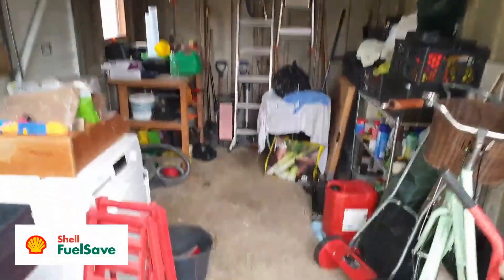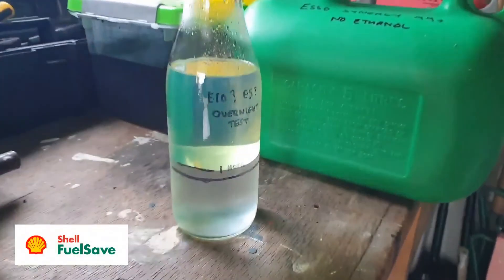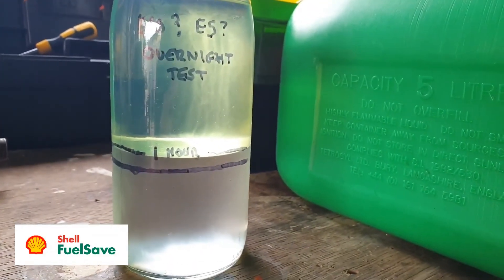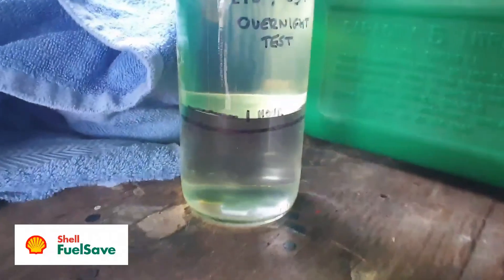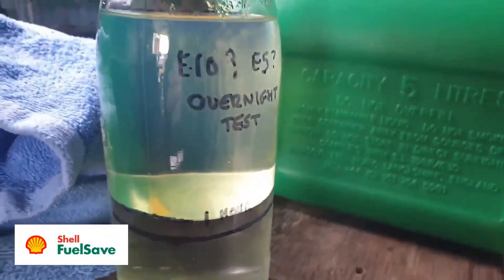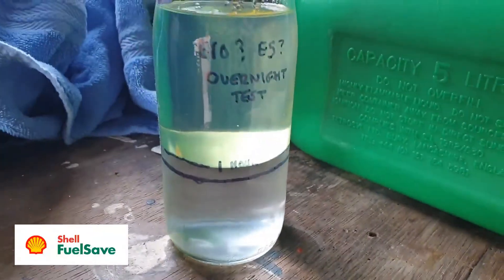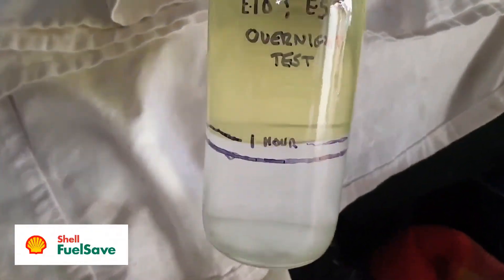Now it's the next day — let's see how our overnight glass bottle test has done. The separation line appears no higher than it was after one hour; in fact it looks lower, but this is likely down to it stabilizing and leaving a thinner, more definitive line than the foggy one traced with the sharpie while settling was still ongoing. This concludes that results after an hour are more than sufficient for our purposes — simply to see that a petrol is either ethanol free or contains a particular amount we can judge as E5 or E10. Remember also that E5 and E10 labels mean anywhere up to that respective percentage of ethanol, not necessarily that amount specifically.